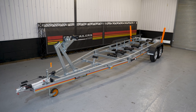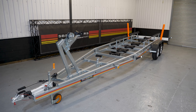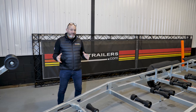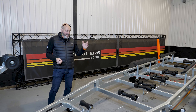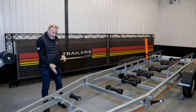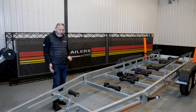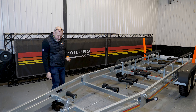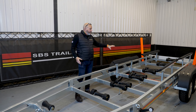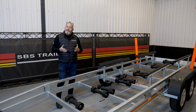We mentioned the security aspects of the coupling and the integrated lock, however equally important — or probably more so — is applying the handbrake. You can see it's a big trailer with big 10-inch hubs, and there are four of them. There's an extended arm on this handbrake lever, and with relatively little effort that applies the right pressure on the cables to ensure those brakes are on. Similarly, because of the longer handle you've got the leverage to take it off.